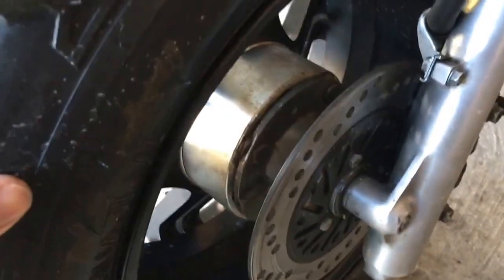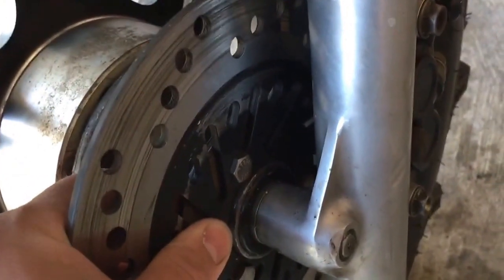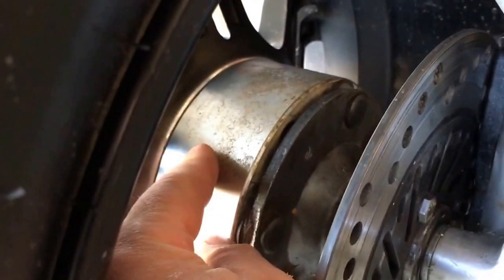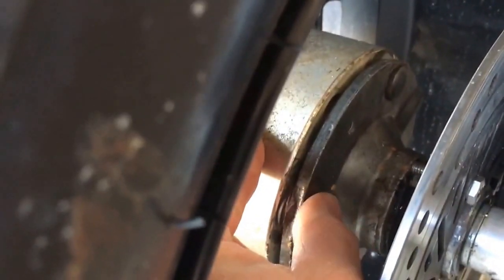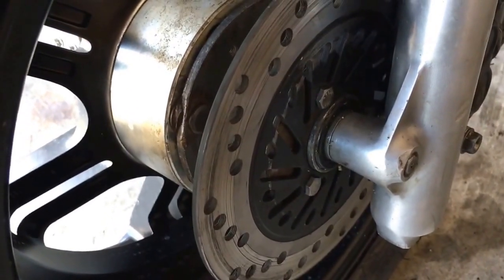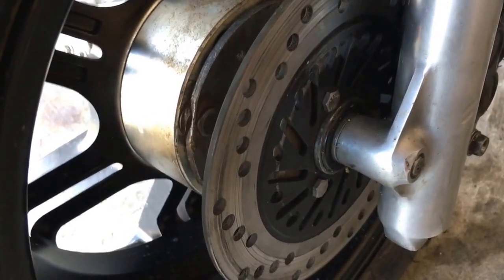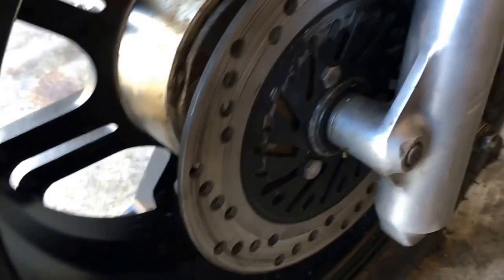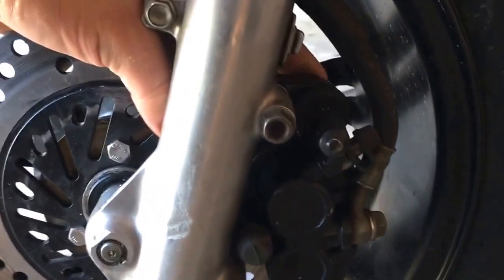How did I make the wheel fit? It's an ATC 250 SX front axle, which is the perfect width to go on your 350X front end. Then all you have to do is find a flange that you space and weld on. You have to use a spacer. Unfortunately my welding buddy with the TIG didn't want to chance warping the tube by cutting off the original backing to slide it over two inches. So in the interest of time and enjoyment, I didn't want to kill myself or a buddy or spend thousands of dollars — I just wanted something that works.